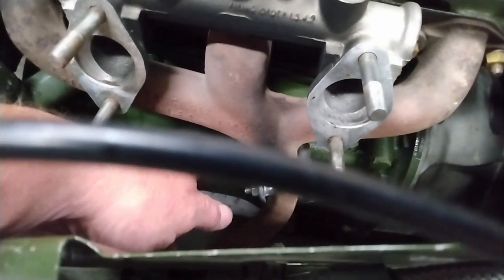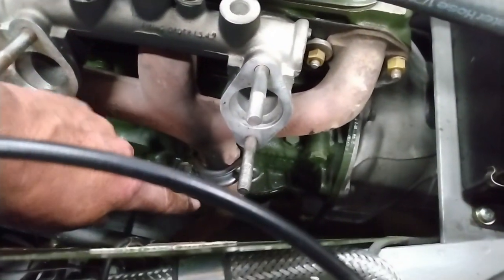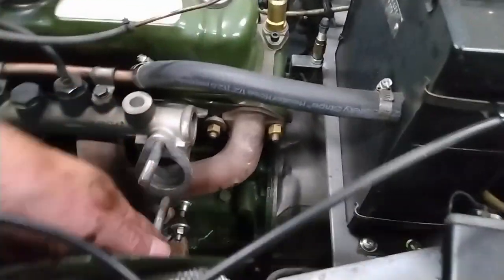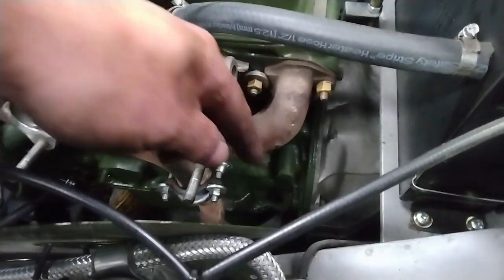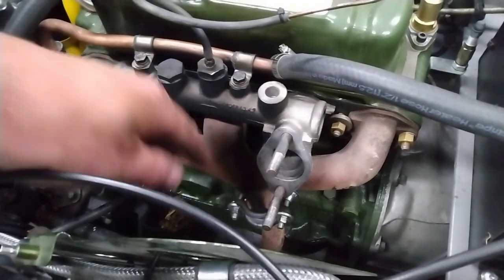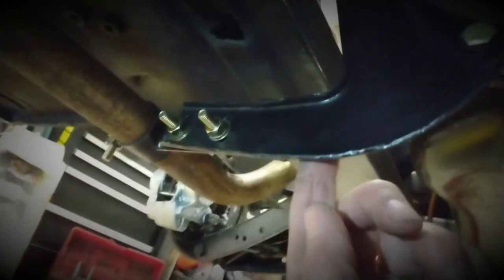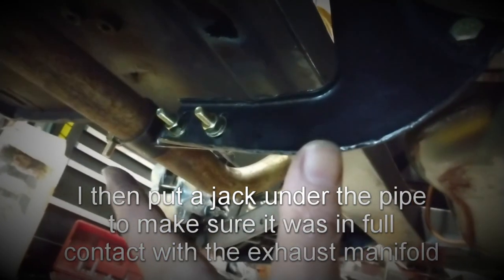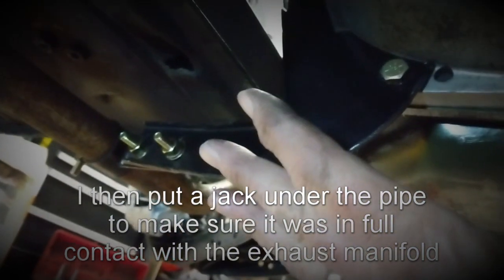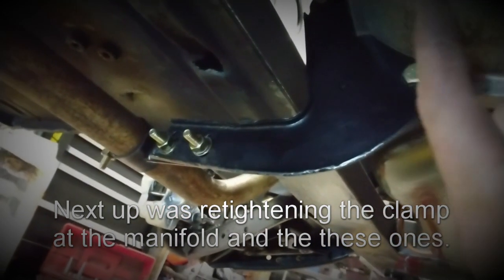So what I'm going to do is take this clamp off, move it around, and see if we can get a better seal on that. I've reclamped the exhaust down pipe to the manifold. What I did is loosen the steady bracket which lines up with the back of the engine, so it gave the pipe a bit of wiggle room and hopefully allowed me to clamp it up a bit tighter. The clamp goes around the pipe and mounts to the front face of this bracket, keeping the exhaust pipe fixed relative to the engine, which helps that old-style clamp on the pipe to the manifold work a lot better.